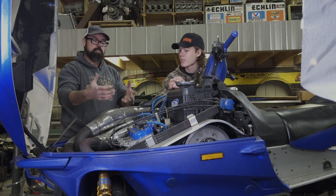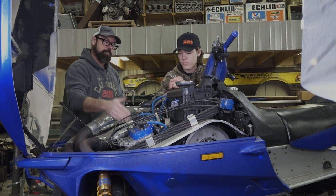Here's a Yamaha tip and a teachable moment — all about naming your snowmobile's cylinders. Whenever somebody's referring to the engine cylinder of a snowmobile, it's either the PTO, middle, or mag side cylinders. PTO stands for power takeoff — that's always the side your power is coming from, so it's the clutch side. Then you've got your middle cylinder and your mag side cylinder, which is the side your ignition's on — the magneto's in there. If you have a twin, the middle cylinder isn't there — you just have PTO and mag side.